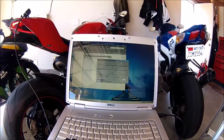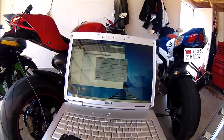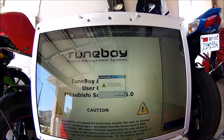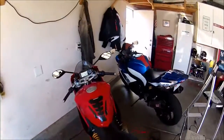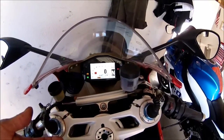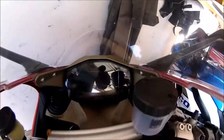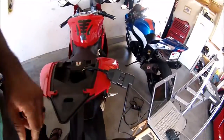Like anything else when you're downloading something, you don't want to interrupt it in the middle. You definitely want to leave it alone and allow it to do its thing. It'll come up and tell you when it's done, then tell you to turn off the motorcycle — that lets me know the flash is complete. I can turn it off. My dash goes back to normal, like when you first started and haven't hit the starter button yet. Now I'm just going to turn it off and disconnect everything.